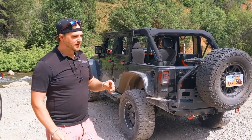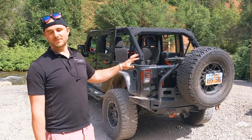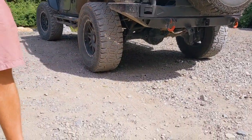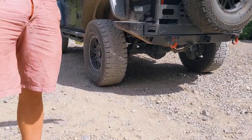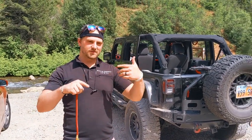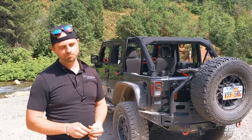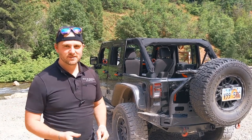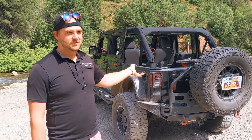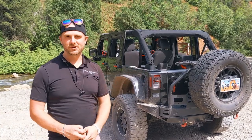Yeah, so it's been re-geared, my axles. In a Jeep, they have two solid axles, and inside the axle there's a pumpkin. That's where the drive shaft goes in, and then it runs to the axles, and those axles spin the tires. There are gears in there, and they have certain ratios. A stock Wrangler usually comes with 3.73, I think. The Jeep Gladiator comes with 4.10s for towing when you get the tow package. And I've re-geared to 4.88, which is even more than that. That helps with towing, and also when you go to bigger tires, it helps so you don't break your axles.